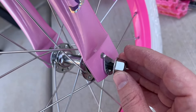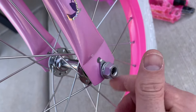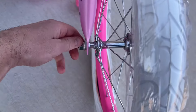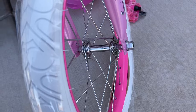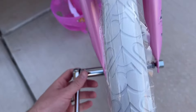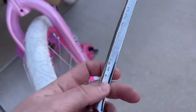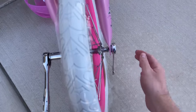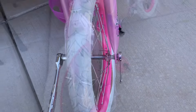We went to the other side and did the same thing — making sure the nut had those perforated lines and that the washer tab went through the hole in the fork. Now that we have it hand-tight on each side, we're going to get our wrenches. We'll use the 15mm socket on one side and the 15mm wrench on the other, using them at the same time to evenly tighten them down so you're going in opposite directions, each turning clockwise.